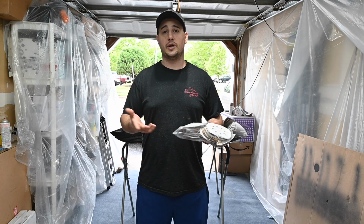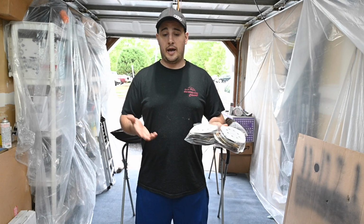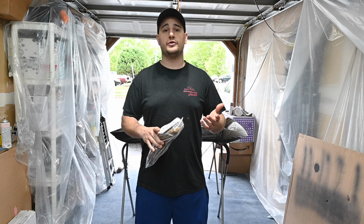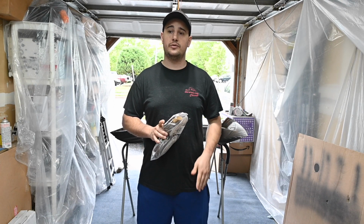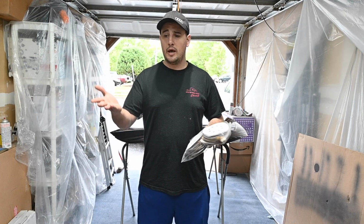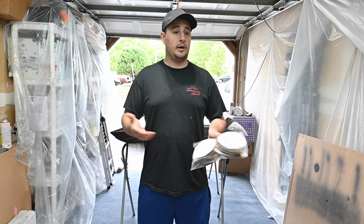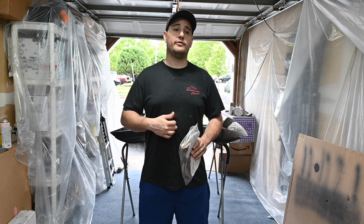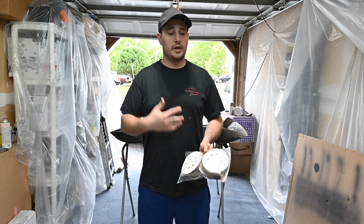I spent $100 on an air compressor off Facebook Marketplace, and I have a toilet paper air filter system for the moisture removal of the actual air compressor. And I have a cooling system that I made makeshift. It was recommended to me by a friend, and it seemed to work perfectly. That was the point of getting basically no fisheyes or anything like that. So I'll show you guys the hood in a second.